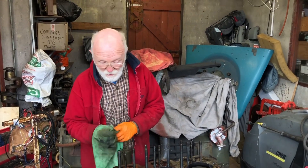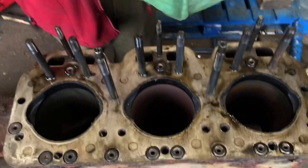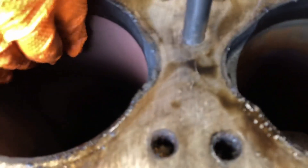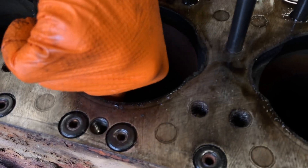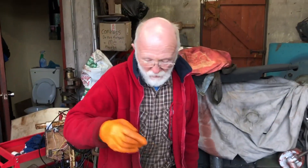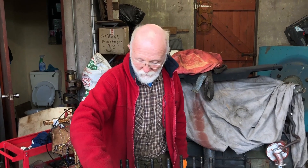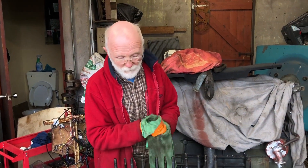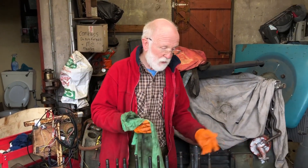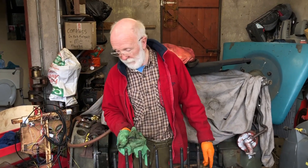We can see there are no major distortions, cracks, or problems with the cylinder head. I can put my finger down here and feel just a little bit of wear, but of course we'll measure all that to see what kind of tolerance we have. I'm not too optimistic — I would say we'll either fit new liners to this engine or bore it out and use oversized pistons. We have new plus-30 oversized pistons we may well use. We'll also take out the whole crankshaft, check it's within tolerance, maybe fit new shells. So we're winning, we're getting on well.